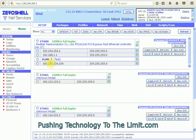Then that way, anybody that gets on my network and I didn't give them prior authorization to be on my network wirelessly, they cannot get an IP address unless they absolutely know what my network address is. They won't be able to gain network access or internet. So that's how you set your DHCP for your computer clients. So now you've got that set up.